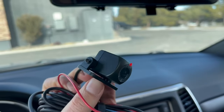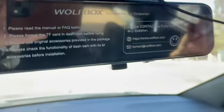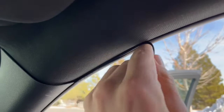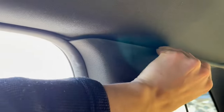It's the same thing — as simple as really plugging it in. The nice thing is this one is on a swivel so you can adjust it. I plugged it in at the top there — that's going to be the backup camera on the back. Then the same thing just on the opposite side: tucking that cord using the tool and your fingers underneath the panels and on the side panel. This one's going to be slightly different because it's going all the way back to the back of the car. It'll vary by car, but I did not have trouble on my Jeep completely hiding this wire from front to back.